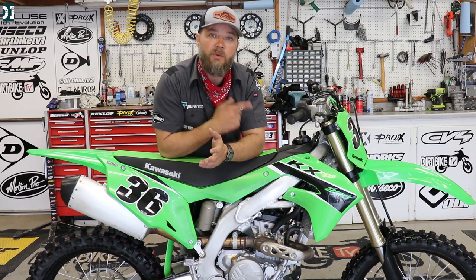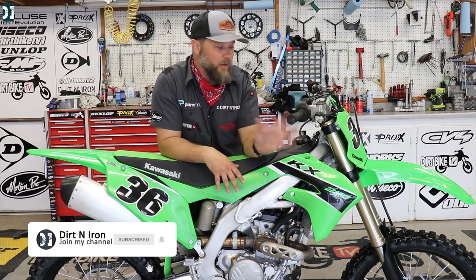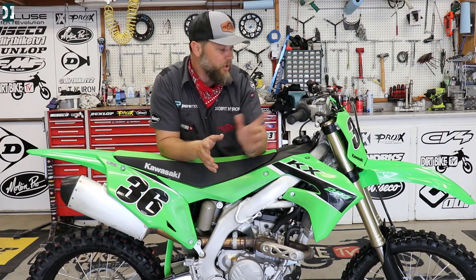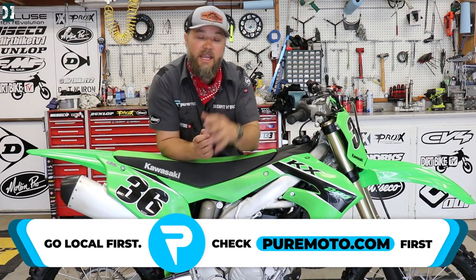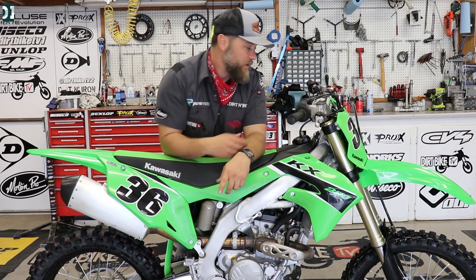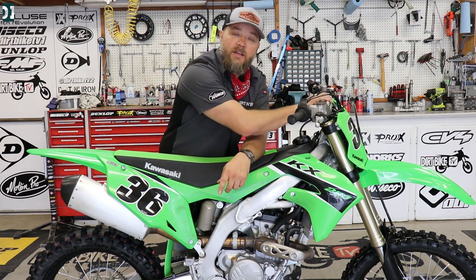I spent a long time on 2022 and last season. This season I want to race this bike — the 2023 — and I want to put a lot of hours on the track. So I definitely want to make it fit my skills, my riding, and also my weight. That was one thing that in the last video did not feel 100%: the fork felt a little bit too stiff for me and it wasn't just working for me. So we're gonna take the suspension fork and shock out today and take it over to Factory Connection.